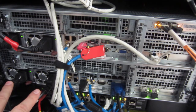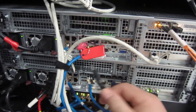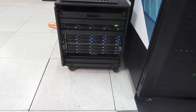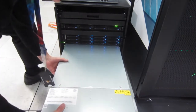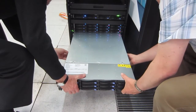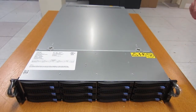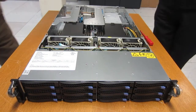Round to the back, the lower of these two servers is the LC922. On the left, the two power supplies and cables. There's a fibre channel over here, VGA to a screen, and a USB keyboard. On the right, we have the BMC service processor. Back round the front, we've taken the door off and we're going to slide the server out of the rack. Mike points out that you can't lift the lid while it's still under the server above — this is a two-man lift. You release the little catches, slide it out, and the outer rail comes with the server. There are two tiny grub screws that are very easy to lose. You push down the little buttons, push the lid back a centimetre, and lift it up to see the insides.